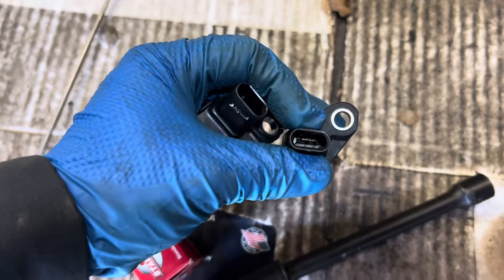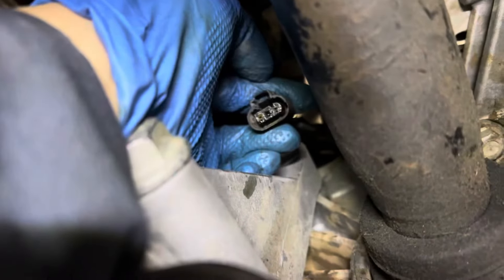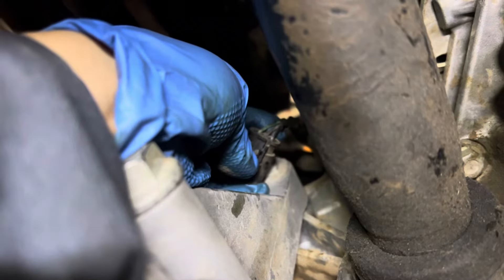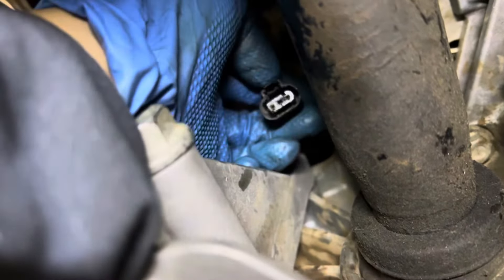I see a little bit of oil inside — actually, it's not oil, it's like mud or water, something that's leaking down to the sensor. Since you're here, check out the connector tube — you can see the connector is kind of wet right here. Make sure to check the wire, make sure it's not damaged or broken, and make sure the pin inside is good. I'm going to clean this out and blow some air through it.